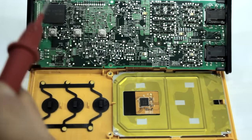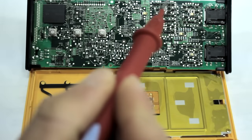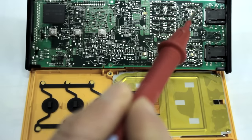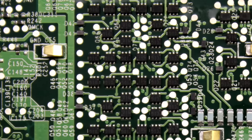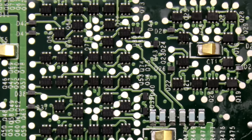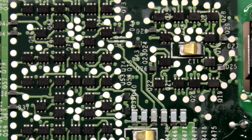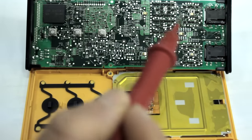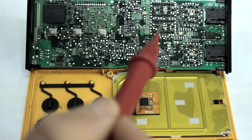I hope they're not pulling an Apple thing and waiting six months to release one with twice as much internal memory. Over here there's a very cool array of about 30 very small chips — these are discrete transistors paired right next to the output section, which includes the headphone jack and the line output jack. Along with those large through-hole capacitors, this comprises the headphone and line out driving section.